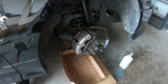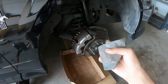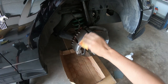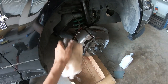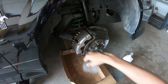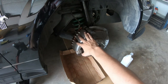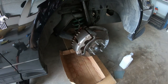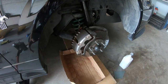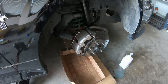Look at that - now we can see the silver caliper, it's looking really great. What I was doing was using the 1500 grit paper, spraying some brake cleaner on it, rubbing it, then cleaning with alcohol so all the dust comes off and gives it that nice shine. It basically takes off all that paint so the new paint can stick onto this. However, the back still has a lot of paint, so I have to go back there with a mask since it'll be enclosed.